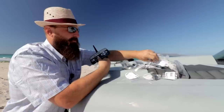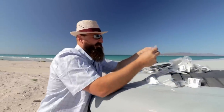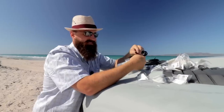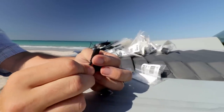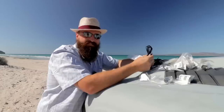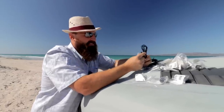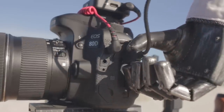Let's set up another camera here and get this. Oh, here's one other thing I wanted to mention. I pulled the power cord out for hardwiring this thing in permanently, and to my surprise, there's a typical USB connector, but it's hardwired to 12 volts. So if you were to ever plug that into anything, your phone, for example, or a camera, any old standard thing that still has a USB connector that's expecting 5 volts, here's what you can expect.